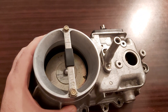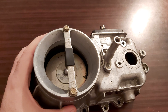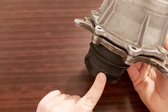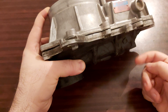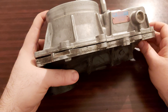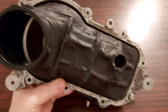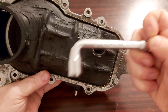Please, when taking it off from your car — let me just take off the fuel distributor, you don't have to take it off from this unit, I will for the purpose of this video — please, and I repeat please, watch out for the hose clamp here that holds the throttle body. You will have to take off this breather hose that connects the idle control valve and the airflow sensor. Now we're going to unscrew — I have only these two, you will have to use something like this, let it just be 10 millimeters.